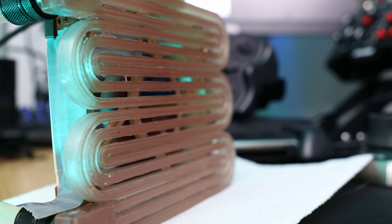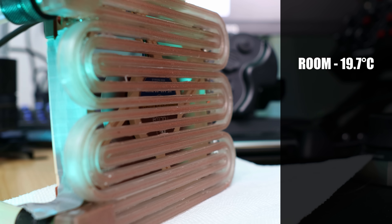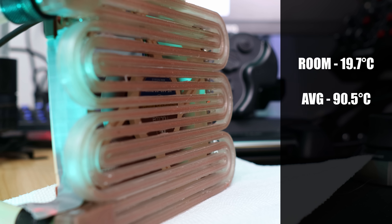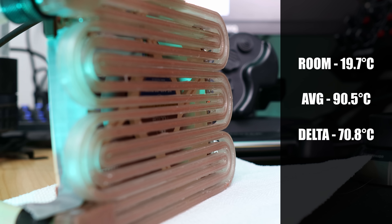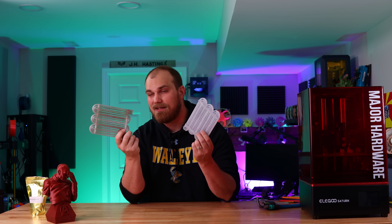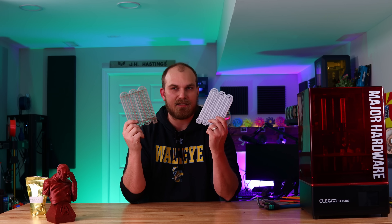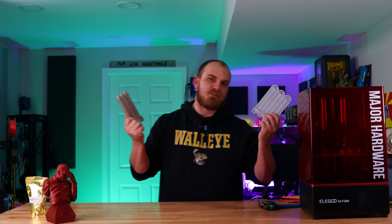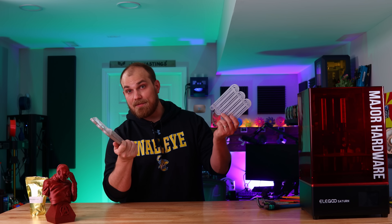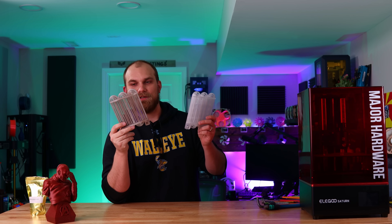The question is: will a little bit of copper make it better? The same design but with a little bit of copper powder had a room temperature of 19.7°C, an average temperature of 89.5°C, giving a delta of 70.8, and again a max temperature of 99 degrees — meaning these two performed identically. You could say this one did a little worse, but in the grand scheme of things that's margin of error, and they came out with essentially the same numbers. They kept it from throttling, but they weren't what you'd call good.